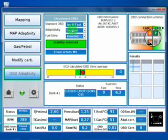And about adaptivity, we can choose to let it enabled. Disable will disconnect the OBD. And frozen type: when we use the frozen adaptivity, we are not adapting in any way, but we are just connecting to OBD to see fuel trims working. So this could be useful if you don't want to use adaptivity, but you want to see how the car is going.